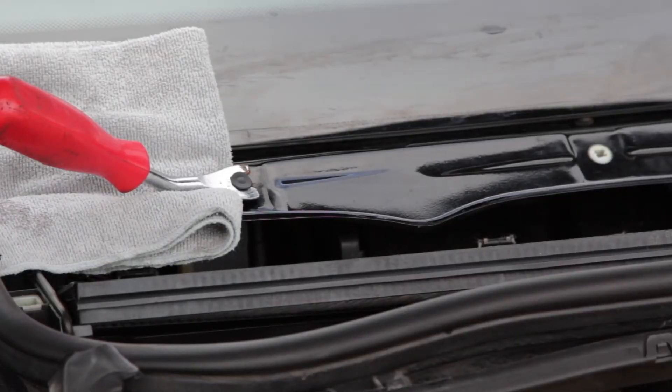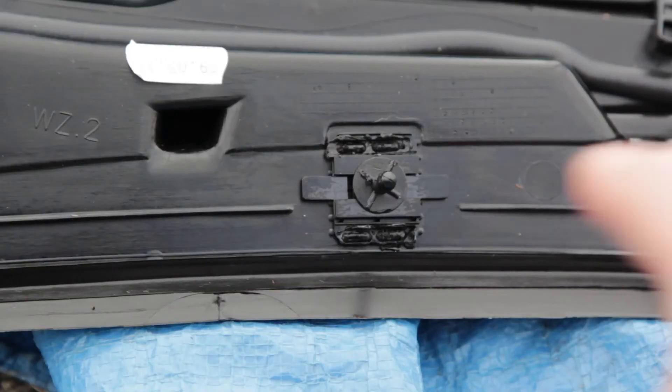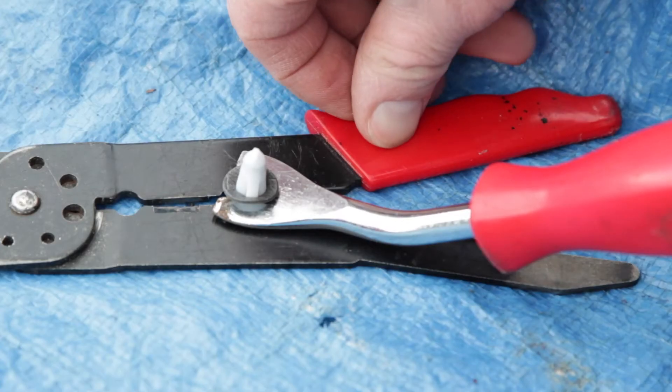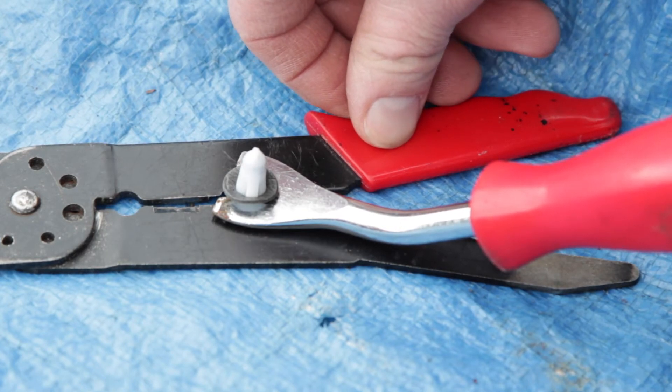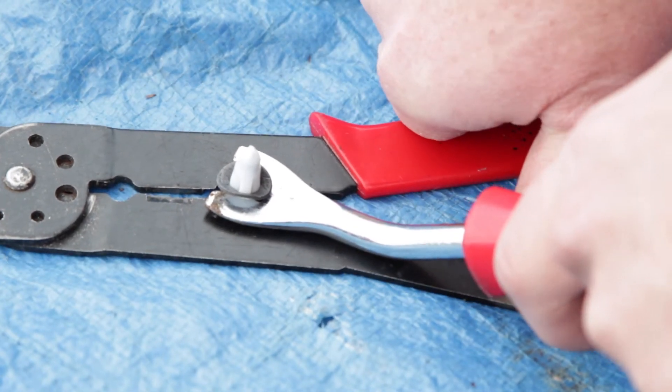Just take a look before you install the new windshield cowl — here's a clip that didn't come out. Really easy to fix that. Just make sure the black clips are in the windshield cowl and the white clips are in the car. You can just reuse the clips in the cowl and on your car. If you need to remove them, I'm sure there's a better way of doing this, but this seemed to work okay.